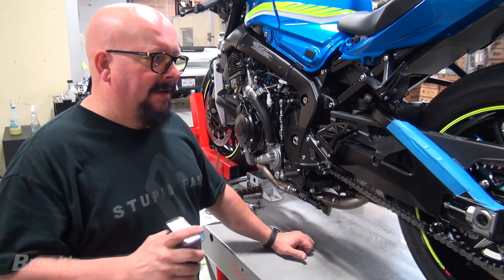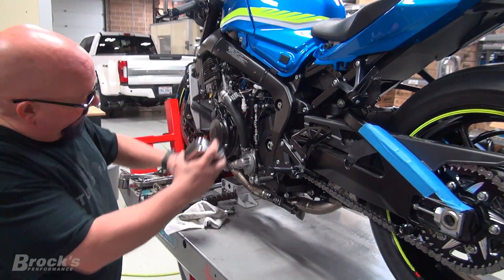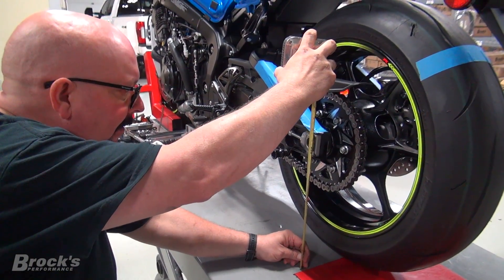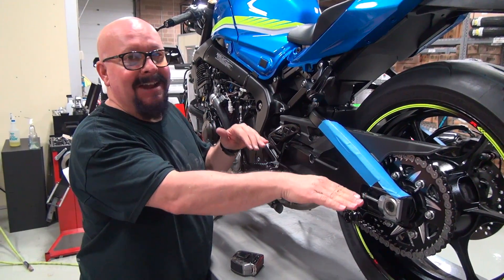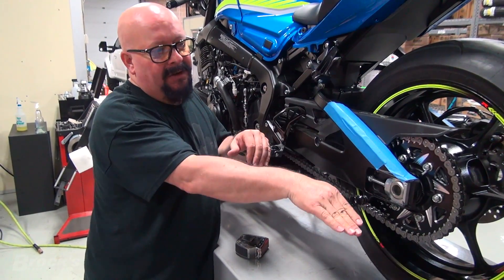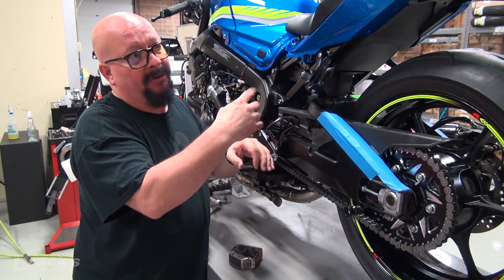It's finally going to happen - I'm moving to the rear of the bike and we are going to get rid of that stock rear fender. I wanted to stop and point something out: now that we have the chassis sitting where we're going to begin, that chain is super tight so I'm going to have to loosen that up. I've taken the bike down off the jack stands. If I measure here we're at about 13 and 3/8 inches, and here we're about 12 and a half. So out of that 4 inches of positive attack angle we had, we've reduced it to nearly nothing. When we launch and the bike squats, it's going to extend this up and tighten the chain a little bit until we get going, where it'll still have a positive angle. The anti-squat will kick in and help plant the tire on the ground.